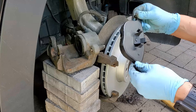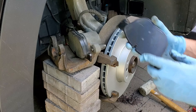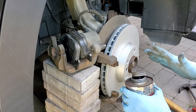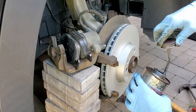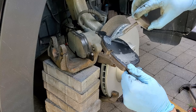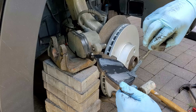This one here is the one with the three clips and those clip inside the piston, so this one goes here and you carefully massage it into place. The other one has a flat back and goes on the other side. Before I do that, I'm going to apply a little bit of grease. These pads didn't come with grease, so I'm using heat-resistant anti-seize on the backside. This will allow the pad to float properly and also reduce any additional noise from metal-on-metal contact as the pad ages.